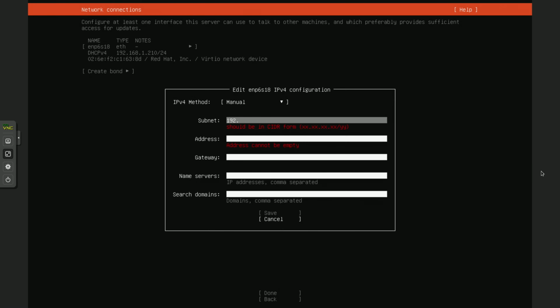So for my subnet, we're going to do 192.168.1. Let's see. What IP do I normally use? So what I do is I have an IP that's assigned specifically for my template. That way, every time I boot it, I know exactly where it is on my network. Give me 1 second while I log in to my router and look at my setup here. I'm pretty sure it's something super high, like 250 or something like that. Template v2 is actually, oh, I did a lower IP on that one. Okay. What's the original template? It doesn't seem to have one, so that's okay. Yeah, okay, I see my logic here.